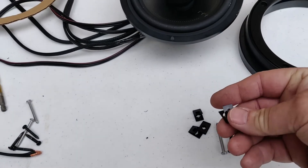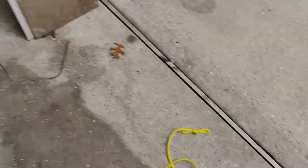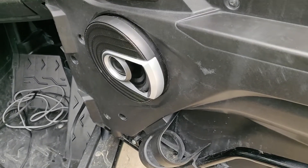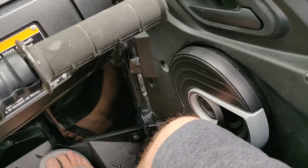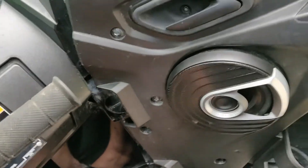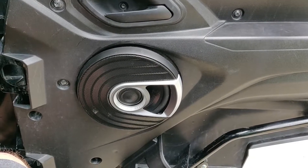Compress these clips with a pair of pliers to get them good and flat and tight so that when they go in they stay and don't move around, and you can get those screws mounted in there. Let's take a look at what the first speaker looks like mounted in place — looks good. It sticks out just a hair more than the factory ones, but that cavity works. It hits a little bit, but I think it would with other speakers as well. You're talking a half inch to get a quality speaker like a Momo in here — they look good.